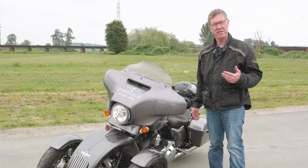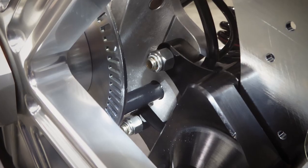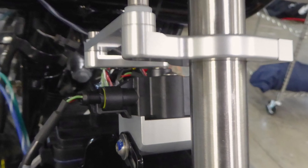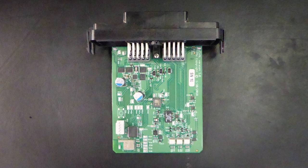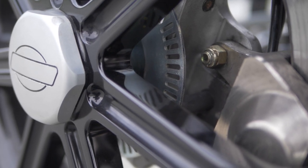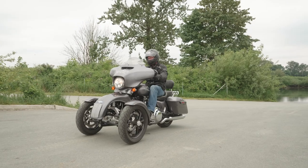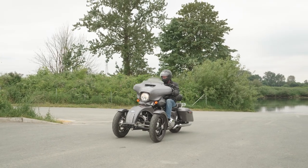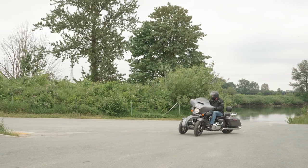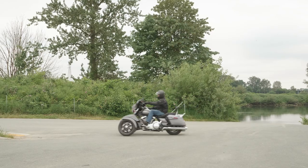The tilt lock system utilizes three types of sensors. There are speed sensors on the wheels, a steering sensor on the steering shaft, and on the circuit board itself there's an accelerometer chip. The speed sensors measure not only the speed but the direction of the wheels, because as the bike is moving in reverse the system is always locked in place. So if you're backing down a hill or a driveway, your tilt lock system will always stay locked and leveling for you.